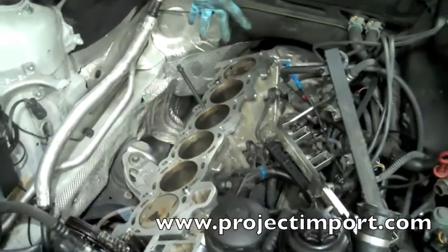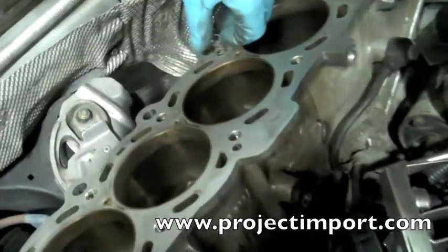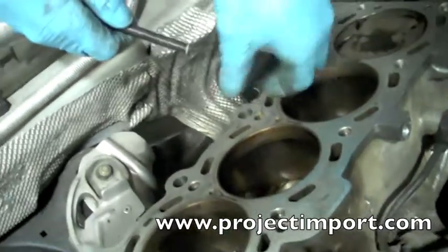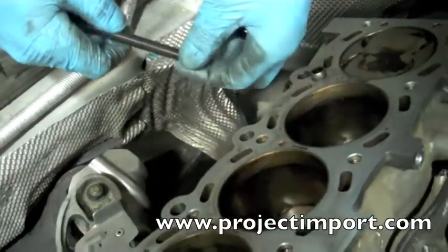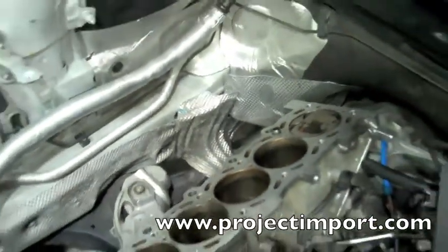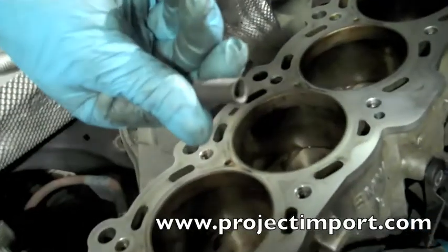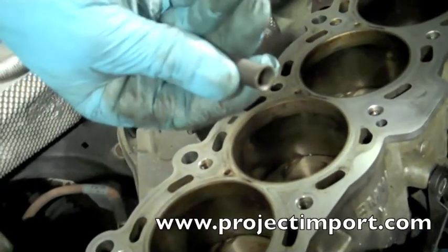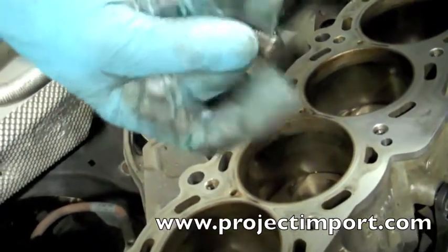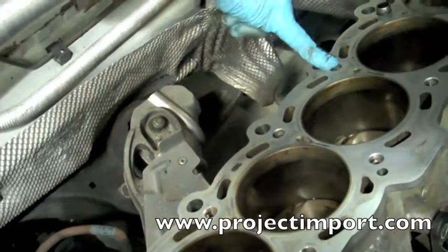A common thing with an overheated motor — there's the threads. We torqued the new head bolts down and actually pulled these threads. So now what I get to do is drill all the threads out and put in TimeSerts. I'll be installing these units into the block of the motor; they'll be loctited into place. This will basically reinforce the thread area of the failed hole.